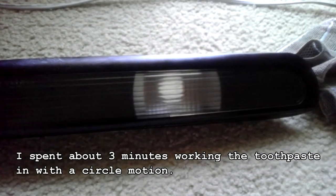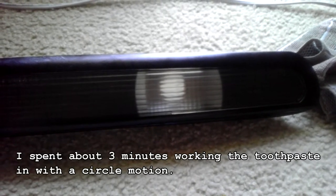I just got done applying the toothpaste and worked it in really good. I have yet to clean it off, but I can already tell how much clearer it is just by looking at it. I'm going to get my cloth with soap and water and wash it off. Here's the end result — as you can see there is a big difference between where it was before and where it is now. It's dry, it's cleaned, it's been restored a little bit, and now I'm ready to start the tint process.